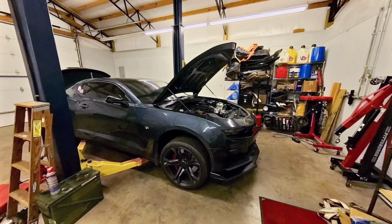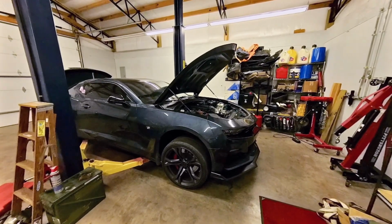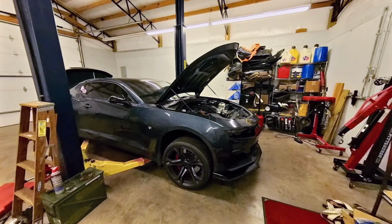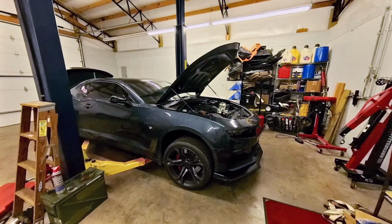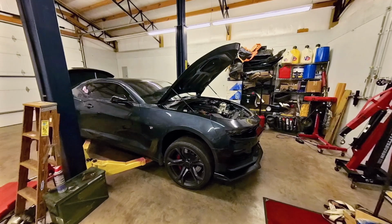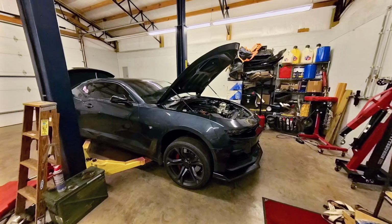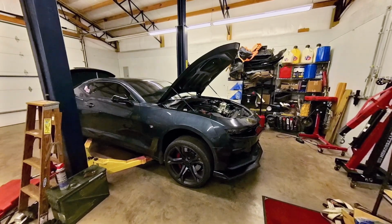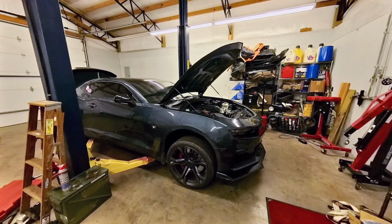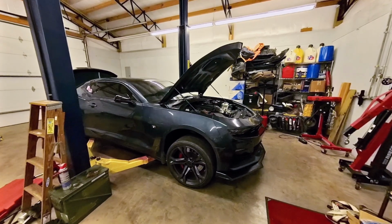And during that process, my oil went from its 35-40 area, whether at idle or cruising, to 80 PSI, to pretty much max. I did not know my oil pressure went up until I had been driving for a little bit. Whenever I was able to stop, my entire engine bay was coated in oil. Ended up leaving the car where it was, got a trailer within the day, I believe, trailered it back home, replaced the front main seal,